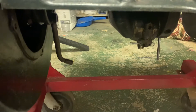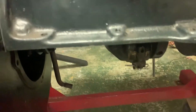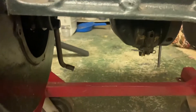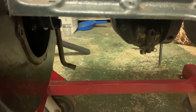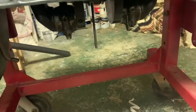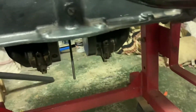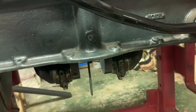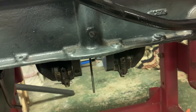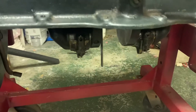When I was taking it apart I just thought it was an old motor because it was all rusty, but I started taking everything apart and there was still break-in grease on everything - all the connecting rods, between all the rings, the valves, everything. I couldn't believe it. The babbitt still had all the shims in it - these are all the original shims. I cleaned this motor up, painted it, and that's when I called and inquired - they told me this was a good motor at one time.